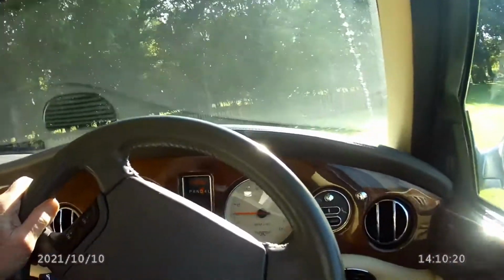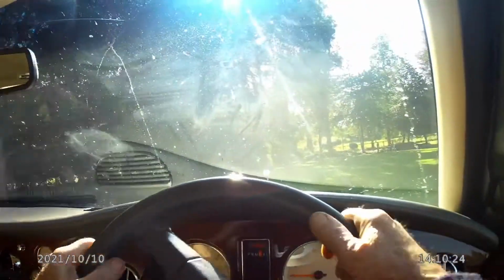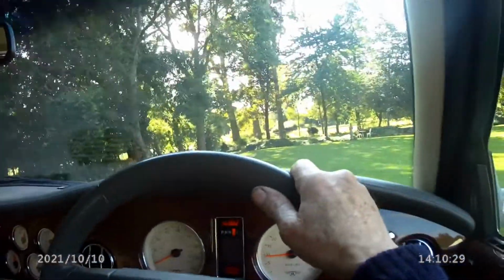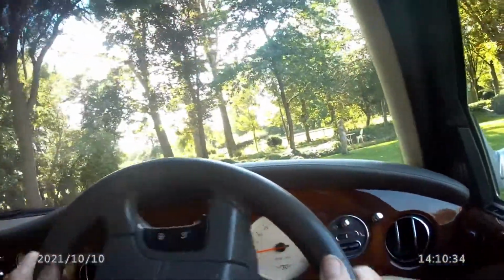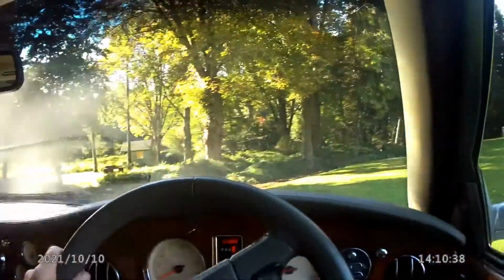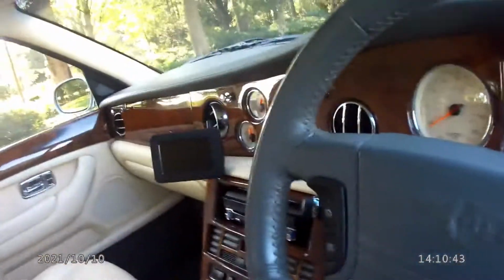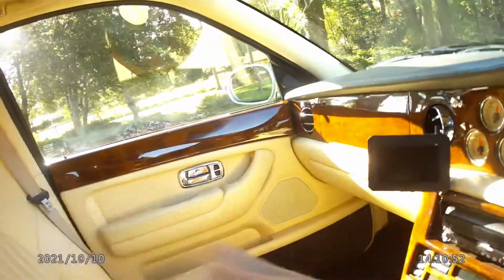I had the smaller 6.3 unit in my Silver Cloud, and I think that was the best configuration. Because it's wet liner, you couldn't bore it, so they stroked it to 6.75, and there were all sorts of problems with head gaskets which I didn't really sort out until they came up with the Bentley T series a few years later. Excuse me.